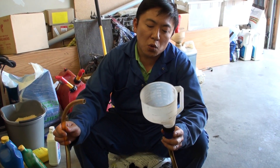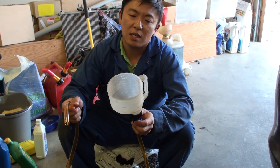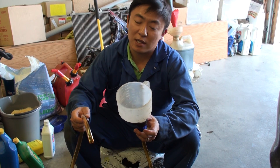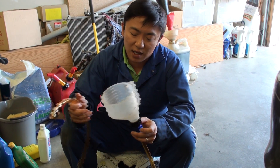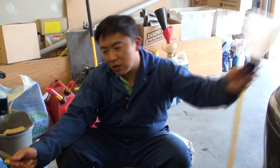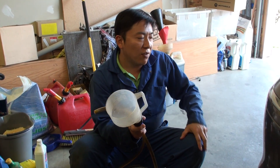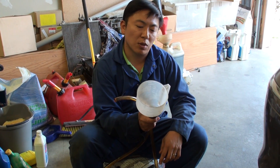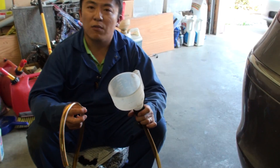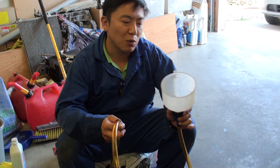There are a multitude of different ways to fill this rear transfer case differential assembly. I've personally used the hand pump method on numerous occasions, but honestly I think that's the inefficient way of filling it because you have to put in over four liters of fluid and you'd be sitting there pumping all day long. What I'm using here is a funnel assembly hooked up to a long tube that we're going to fish through the rear driver's side wheel well, then start off by filling the hypoid gear assembly. The reason I like filling it this way is that you can move a lot of fluid into the transfer case very quickly with relatively minimal mess.